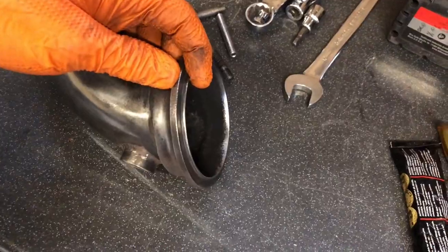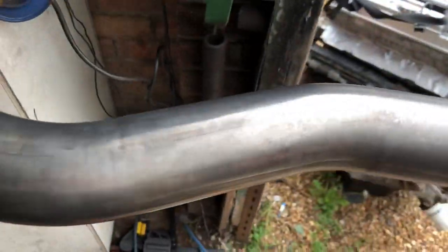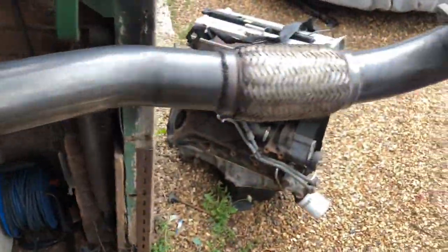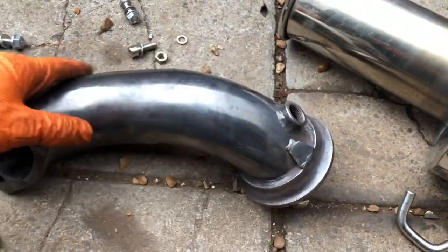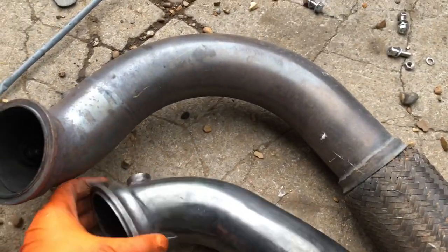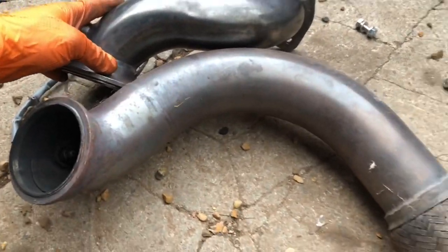You've got to make sure you've got one with that lip because if you don't, there's no point trying to get it to seal - it's always going to blow. I'm giving this exhaust a little clean up as well because it's got a bit of surface rust. I just found out this is a Cobra section which is actually quite nice, instead of the Miltek section on the front. I've also done the decat pipe, going to weld in the AFR bung for a lambda sensor. In the future I'm going to change over to a 3 inch exhaust.